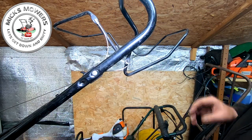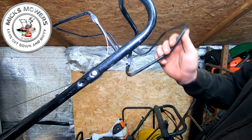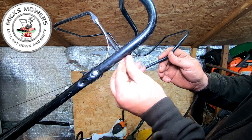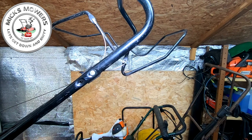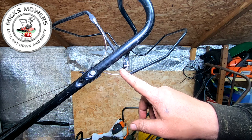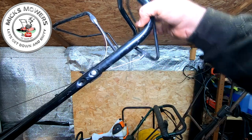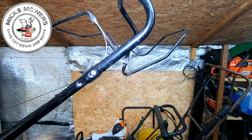So that cable is exactly where I expect it to be. I would say that it could possibly come off at some point. But as long as you tell the person, if it comes off, all you've got to do is poke it back in the hole. It's common sense, right? Take 2 seconds and away you go again. So that cable is now fully working. And as I say, we haven't had to buy a new cable. £14 for 30 metres of that. I use loads of it, and I've used about £2. So if you had a spare bit of an old push bike lying around, long enough cable, a back repair for that drive cable could have cost you about £3.50. Okay. Cables for these, £17 plus.